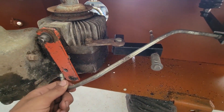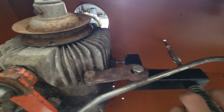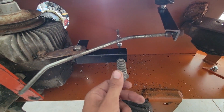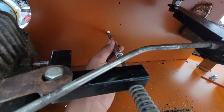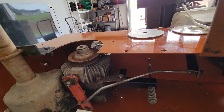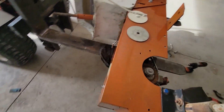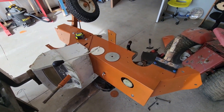All this is still a work in progress — nothing is actually done, I was just showing you the basic concept. The hydro lever: you pull that up and it pushes that pin in, which makes it so you can actually release the hydro and be able to drive it. There's a spring here so that when you push it up, it has a little bit of spring resistance, and an adjustment so you can dial it in exactly right. Had to cut a hole on the side to make sure the pulley and fan fit when that gets put on. I need a bracket welded onto the steering box to push on the triangle piece that operates the steering, and I had to cut a hole in the top of the frame for the oil reservoir. It's slowly coming together.